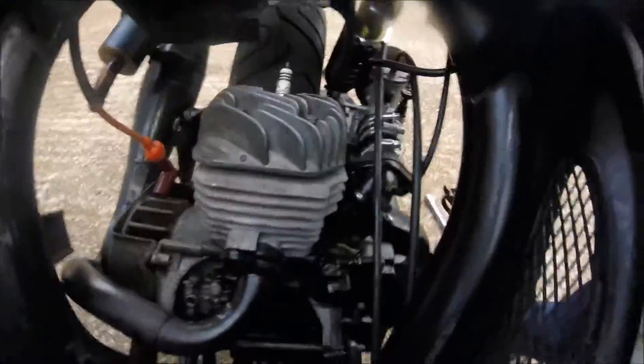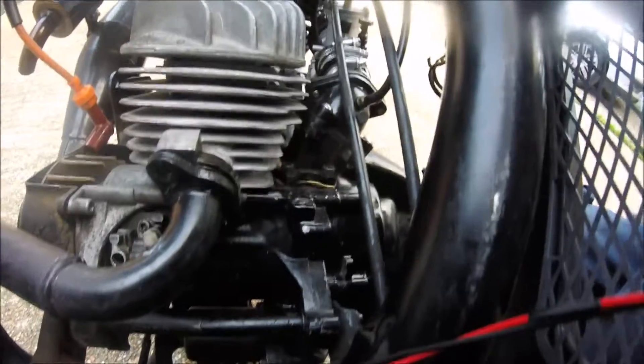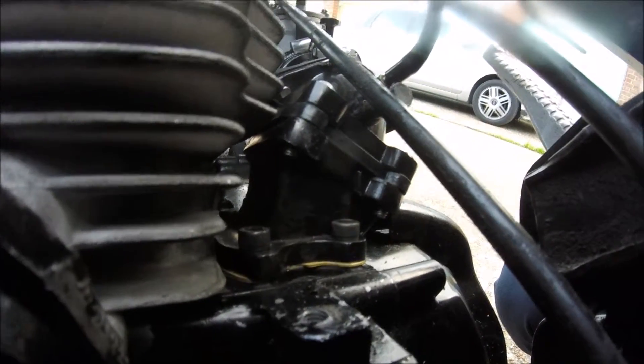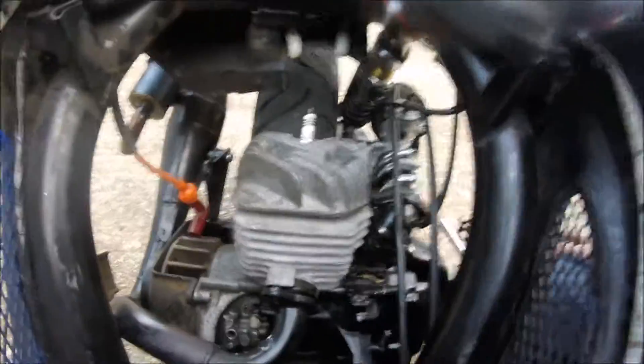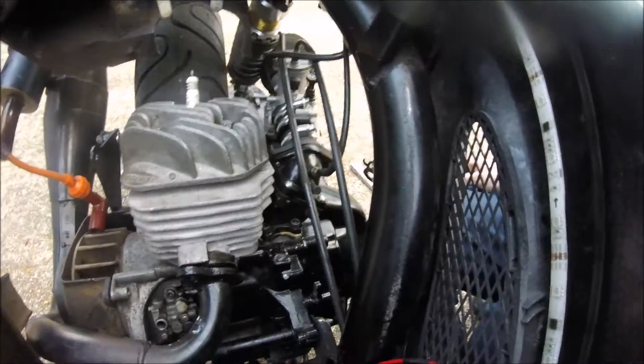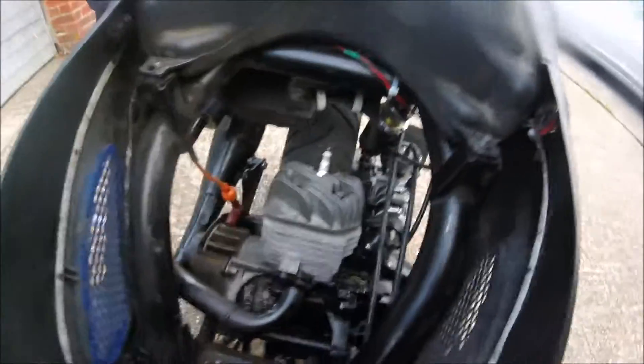The reason why one of the fins has to be cut down is because when you have the Stage Six inlet manifold, the bottom fin pretty much nearly touched it before. Now with it cut down, it doesn't — the issue is it will actually melt. You've also got to cut the plastic casing that goes over your bore to accommodate the Stage Six inlet manifold. That's the setup with a Stage Six inlet manifold on a 120cc Malossi bore kit, and that's the reason why you have to do it. Thank you for watching.